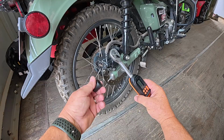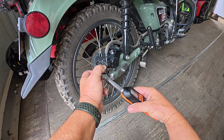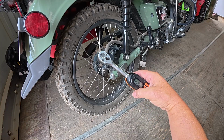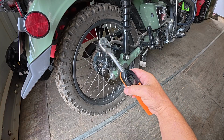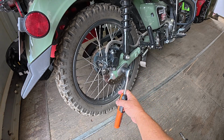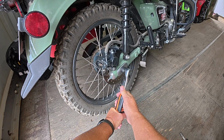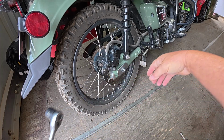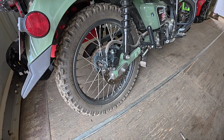Okay, so I got my Suzuki digital torque wrench here. Got it set on 40-foot pound, but I need to torque this back. You could use a regular one, but this one comes in pretty handy. There's a link to this below in the description also. We'll set this on 40. Well, there we go. So now we got it torqued back to where it's supposed to be.